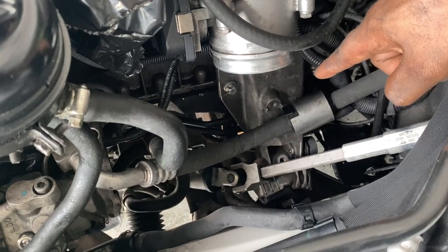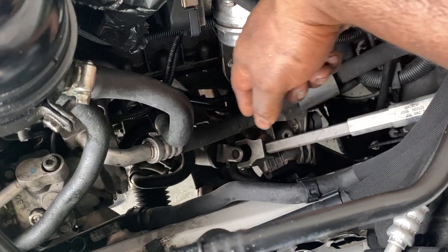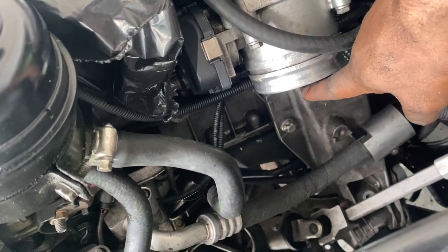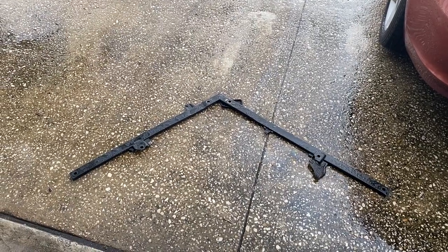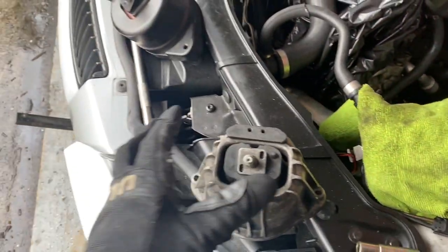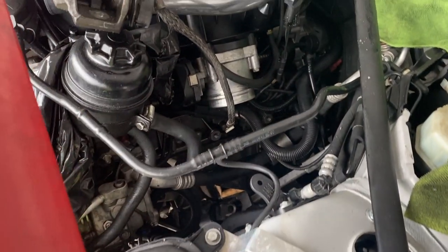I was trying to avoid taking off the motor mount bracket — I just wanted to see if I could squeeze it out from the bottom, but I can't. So I have the motor mount loose but there's no way to get it out. I'm going to go ahead and take off the charge pipe, which I already removed, and take the bolts off for the bracket — about four bolts — move that out of the way and pull the mount right up and reinstall the new one. The rain got to it before I could wash it off, but free water. I got the mount off — the old one is out and I'm about to drop the new one in.